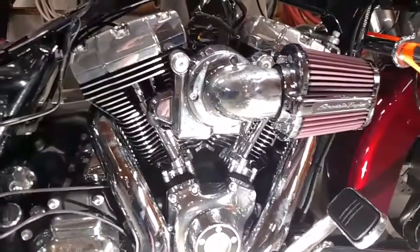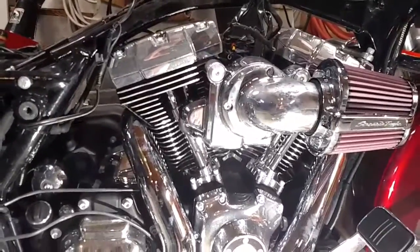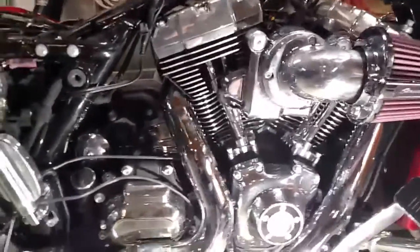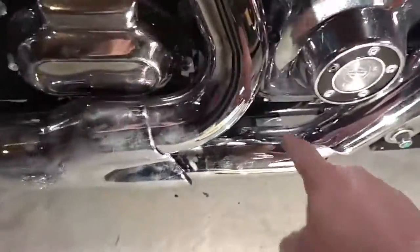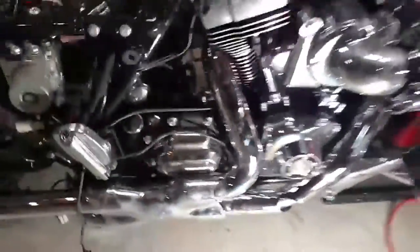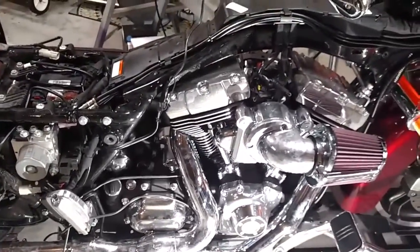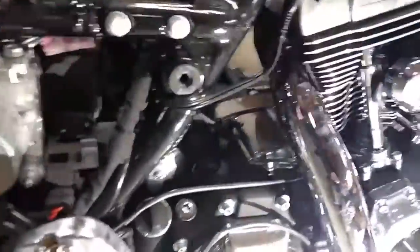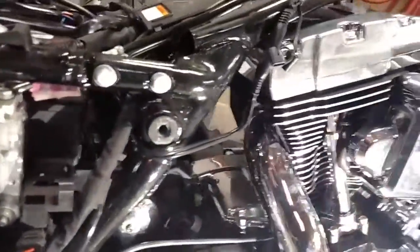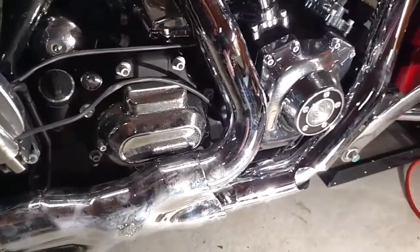Probably most of us who work on these things have pretty big hands, but once you get them going, there's also a bottom bracket down here that's a little tricky. You get them in place, cinch them up together, torque down the flanges, and bring them in together to compress equally. So this whole pipe is just tight to the motor and transmission assembly now.